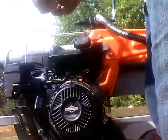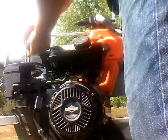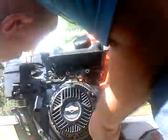Now, put this back on. Make sure this hose gets put back in the hole it goes in over here. Just like so. Okay, we will get the long 8mm screw that goes in the back. And make sure it's lined up properly. You can see what I'm doing here. Okay, it's in. And now we got the two little 10mm nuts here to put back on.